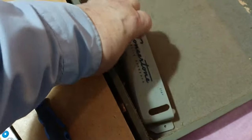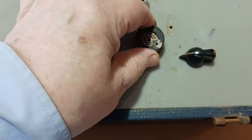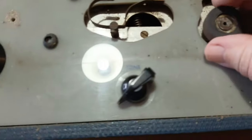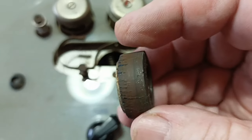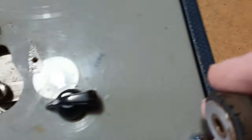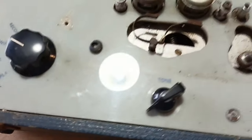I did have this off before — just this little bit, on the pinch roller. Let me just take that washer off there. It's showing its age, shall we say. It's not really up to it. Now, people say that IPA will dry out rubber — I think age dries out rubber. It's got really good oxide in there, and you can see it is as hard as a rock. It has petrified. And that is a perennial problem.